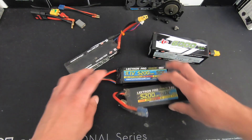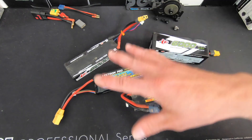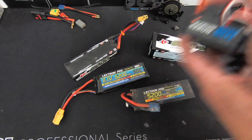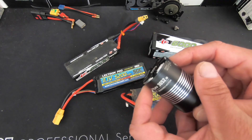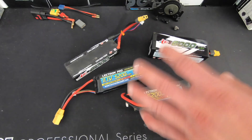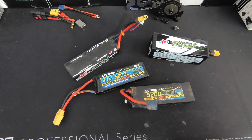My favorite topic I run into on a regular basis is what I call the dual voltage phenomenon. Item number four: dual voltage setups are not really a thing. Lots of setups are advertised as working on 2S or 3S, 3S and 4S, or 4S to 6S. Your speed control will have a voltage range rating — say, 3S to 8S — but the motor you use really determines what voltage you're going to run. A setup that runs awesome on 2S is probably going to overheat on 3S, and if it runs well on 3S, it'll be a little boring on 2S.